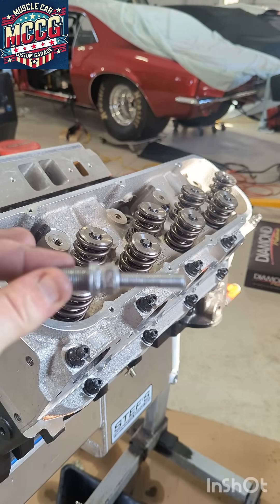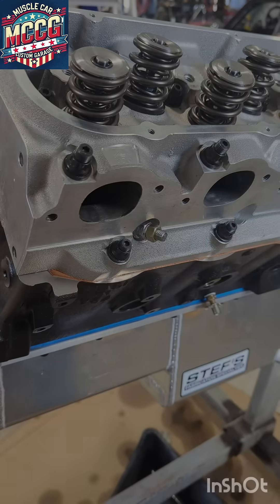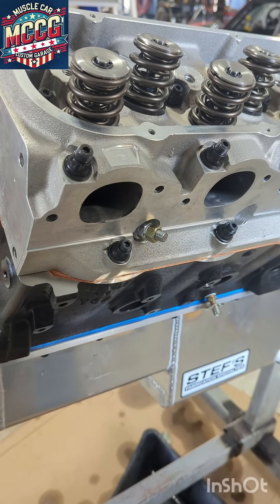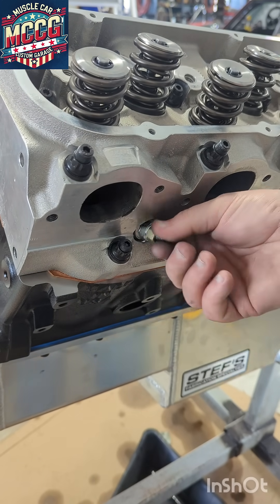That is exactly 3-1/2 inches long of a stud. Let's put it in the motor and give it a try. Got it locked in the motor. I ended up putting a 9/16 nut on it to lock the stud in when establishing top dead center, and you can still get your 5/8s wrench on it.